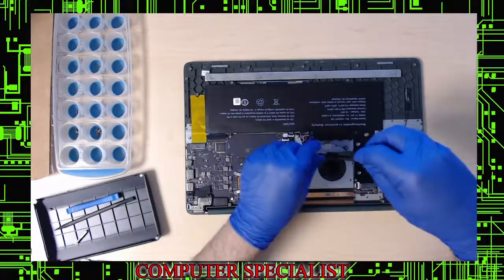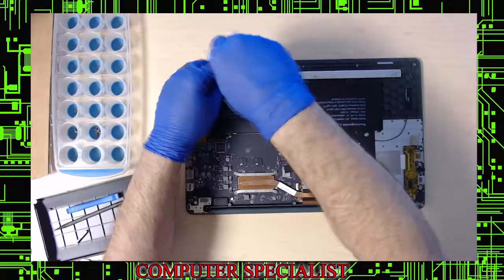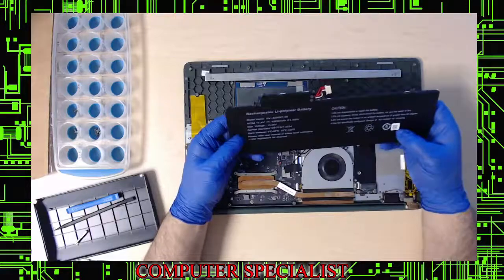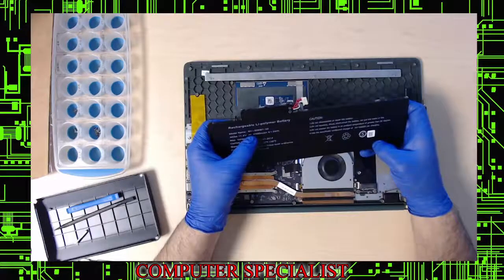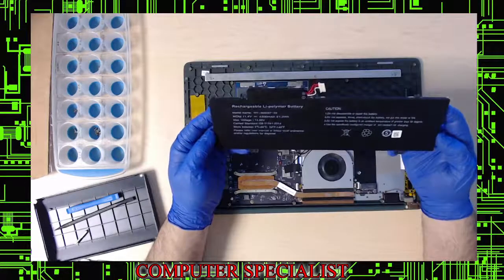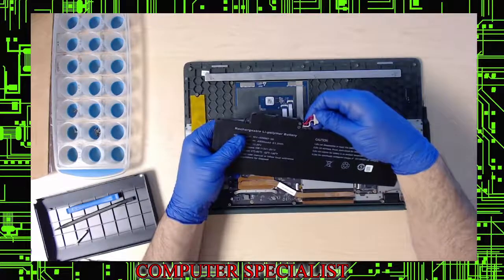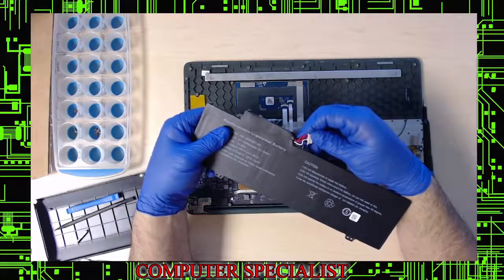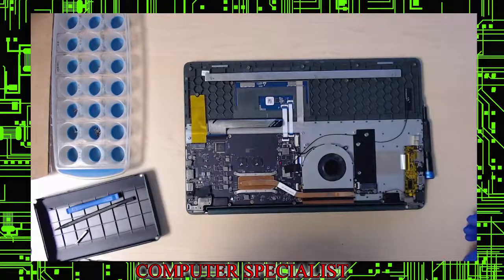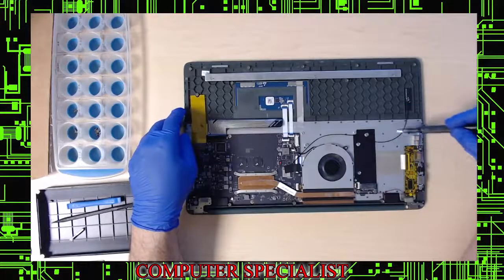For people looking to replace the battery — this is about as simple as it gets. The battery model number is NV-509067-3S. It has an aftermarket look but it's the legit Gateway battery. The pin configuration is three black, space, one white, two spaces, three red — make sure you match yours up when buying a replacement, as people do list them incorrectly.